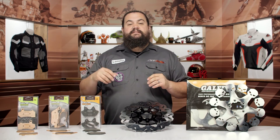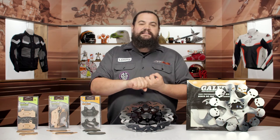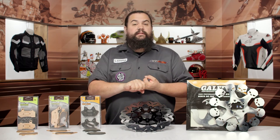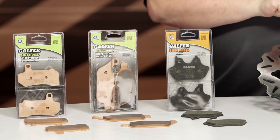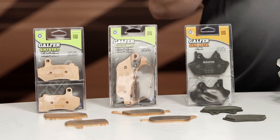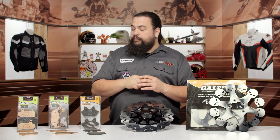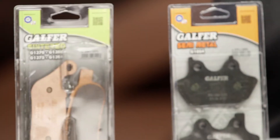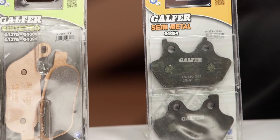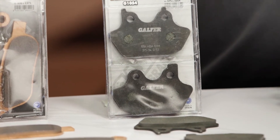One of the things you should be aware of is that in order to attain that high level of braking friction, they're very aggressive to rotors. They want to be run at really hot temperatures, and these things can also be a little bit noisy. These are specifically designed for hot rod riders — if you're riding your bike really, really hard and you're really working out the brakes, a sintered pad might be for you. However, if you're kind of a Sunday driver, there are other products that might work better. The other group of riders who might want to consider a pad like this are those riding a heavy bike loaded up for touring, where it's very easy to heat the brakes quickly, and a sintered pad can handle the assault that a heavy bike places onto the brake pads.